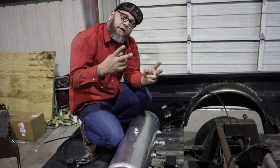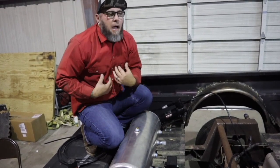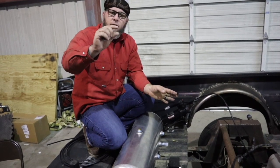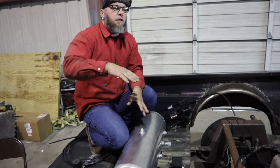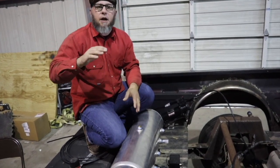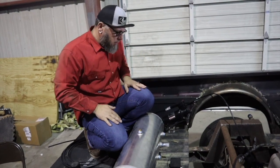Inside the truck, we have dual needle gauges, two dual needle gauges. One of them will have your two fronts, the other will have your two backs. You don't have to run gauges. I personally like to run gauges. That way I'm never guessing where my truck is sitting. Once you get your setup going, you get your skate where you know you can skate and still turn. See what pressure it is, boom, you're good. Get it up to where, hey, I'm pulling into somewhere and I need to be off the ground. Boom, you got that. That way you can see where your truck's at, you know what your PSIs are, and then you look at your PSI and you know where your truck's sitting.